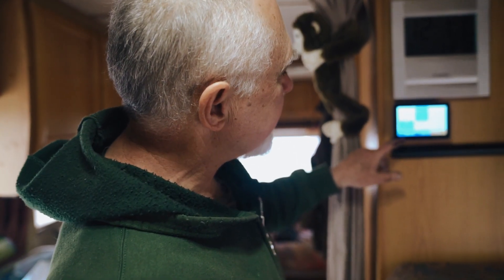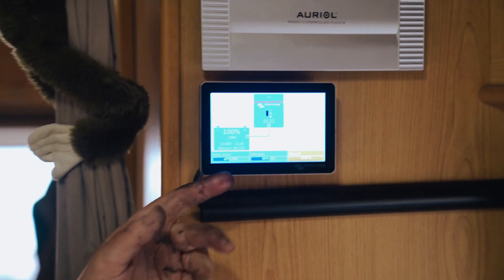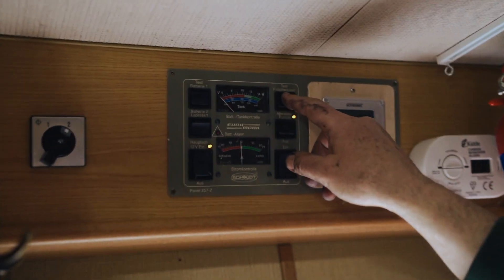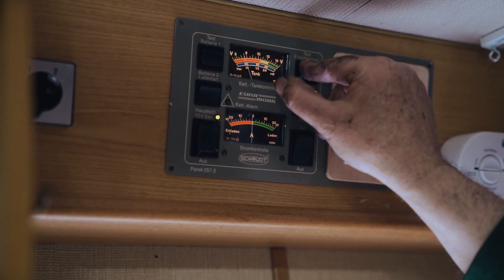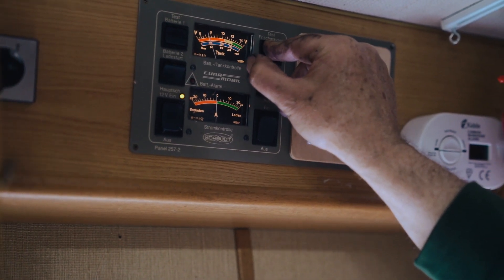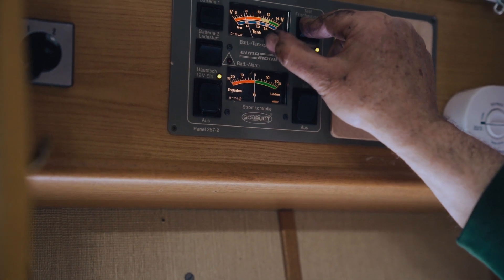We were at 51%, ran a little bit of water out of the tank just to get it below 51%. This is now showing 47% — may need to calibrate it, because I don't think we used that much, but at least it's showing us just under 50%. However, when we look at the original one, it's showing us that we are at one quarter. So what this is actually telling us is we're between a quarter and a half, and we happen to know we are very close to half. If you're away and you think you've got a quarter of a tank left, you're going to conserve it, whereas actually you've got a half and you can carry on using it happily. I hope that is useful to anybody wanting to mount a tank sender into their fresh water tank and connect it to their Cerbo, and then sit in your lounge and look at your water levels, LPG levels, temperature — everything to do with your van. Thanks folks, see you in the next episode, cheers.